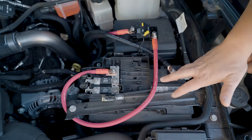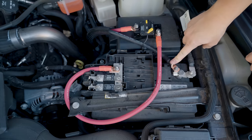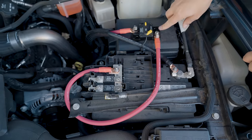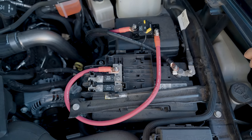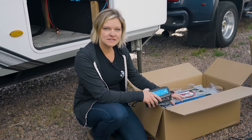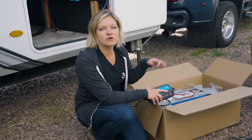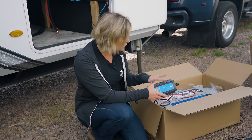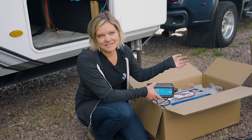This is the OEM truck battery: we've got our negative wire coming up here and we need to attach that to the negative post of the battery, and then our positive wire coming into our 150-amp breaker and then into the positive side of the battery. Now it's time to wire up our battery bank. We're using two BattleBorn GC3s, which are 270 amp-hours each, and we're going to be wiring these in series to form a 24-volt battery bank. We've gone ahead and charged them up overnight using our Blue Smart Charger so that they are both fully charged before we wire them in series, as per recommendation by BattleBorn.